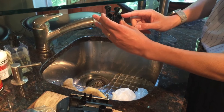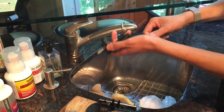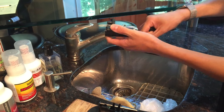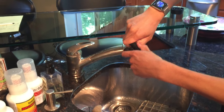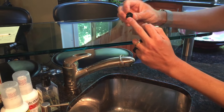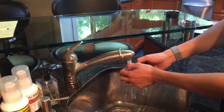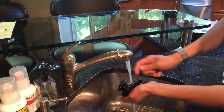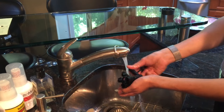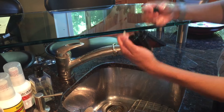First of all, the most important thing to clean — you've got to yank this plastic piece out, and all of these plastic pieces out of here. Get these out and make sure all these little holes inside are clear. There's a little hole here so you have to yank both of them out and run them through hot water. If you have a little brush you can stick it in and brush it, and make sure all the debris are out of there, because if there are any calcium deposits along these lines you are not going to get froth milk. So if you want foamy milk, you've got to make sure you clean all of these.